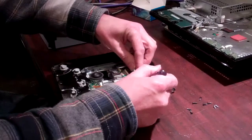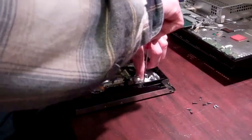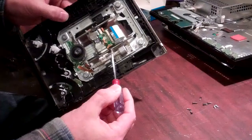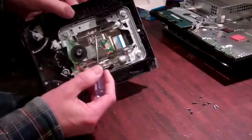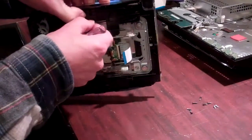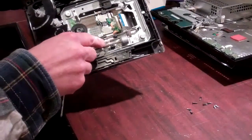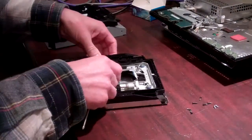This way, you're removing the laser by only taking out one screw, and you don't have to disturb too much. This is the clip that holds the rear bar down — the guide rail. That's the one screw you remove. You've got to make sure that the left side actually fits. There's a little groove in the laser assembly that sits on the rail. Once it's in, make sure it glides freely, because sometimes this binds, and you have to pop that down onto the stepper motor again.